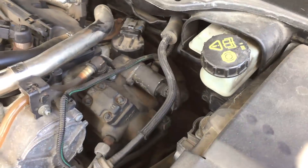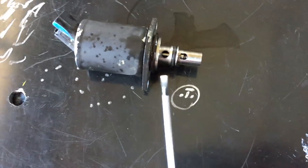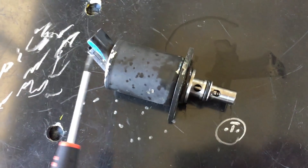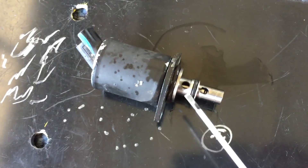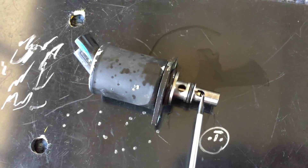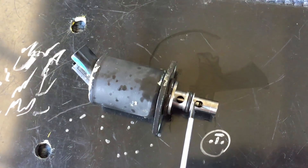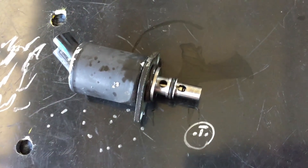There is one bolt over here, one over here. Let's take a closer look. We have two seals, one hole and two holes on both sides. When I apply voltage to the electromagnet that is inside, this part inside moves. When it moves it unlocks the connection between this side and this side. Thanks to that the fuel is released to the fuel rail. With power pulses you can keep this valve open at just the right place so the fuel pressure stays at the correct level. If the valve is dirty or stuck with something it will just stay shut or stay fully open, causing the issues I'm experiencing.